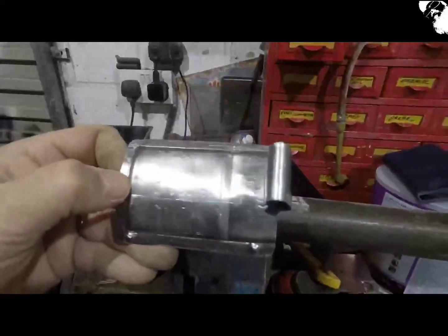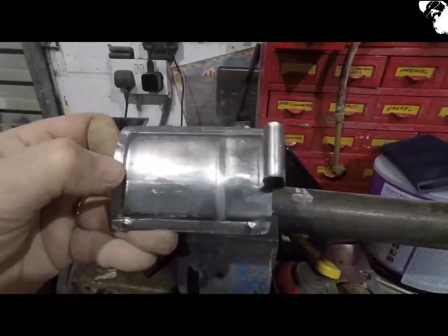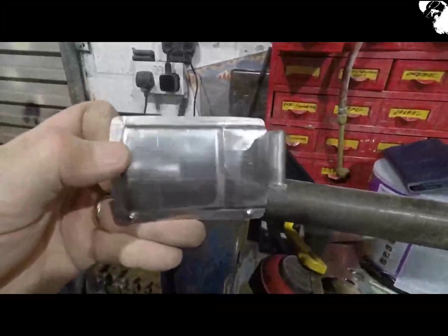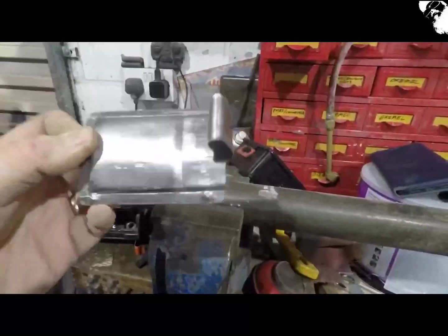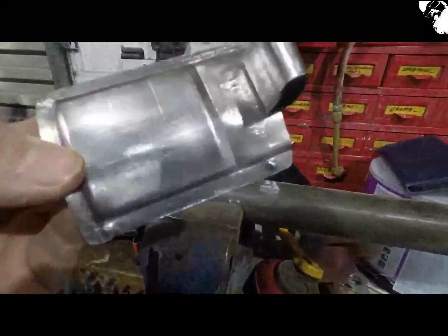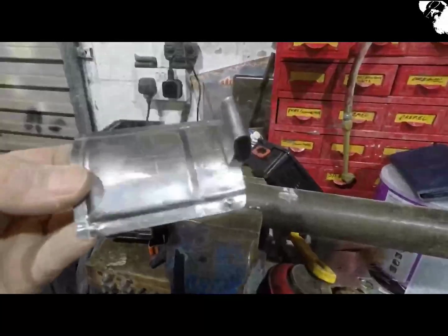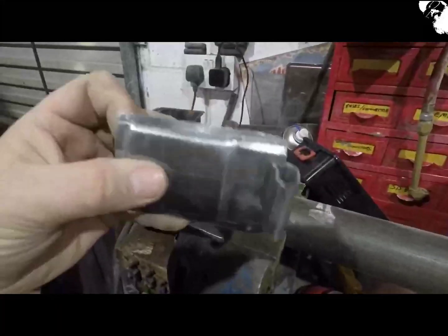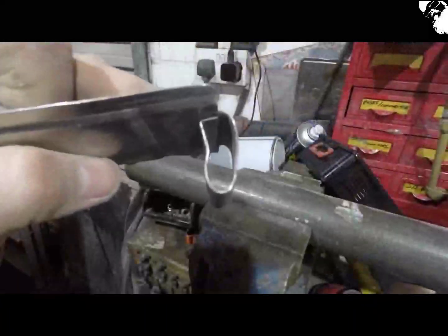Could you guess what I was making? They're actually the closing plates for the heater channel vents up in the front footwell. There's still a lot of work on the heater channel itself to make a nice little sliding channel for it to pass back and forth on. The dimples I've just put in the bottom should actually help as a stop when it's sliding along. I may need to trim a little bit of material off each side, and I'm also going to put a hole on the reverse side and do a little plug weld just to strengthen that clip up.